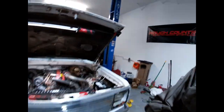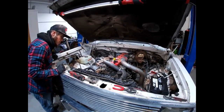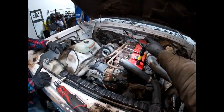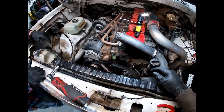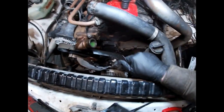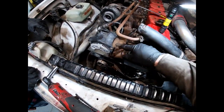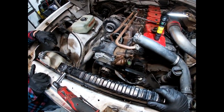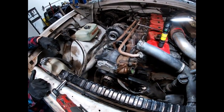We're back and we got to do a little bit of work on Skid Mark. You saw yesterday on the test drive that the temperature gauge was all over the place. We don't know how this thing was maintained previously - probably wasn't, by the way the truck looks. We noticed the fan clutch, so we're going to change that, do the thermostat, do the water pump, and figure out the charging issue with the alternator because it's not charging.